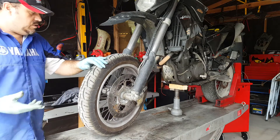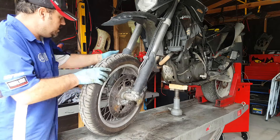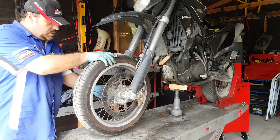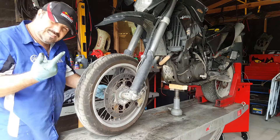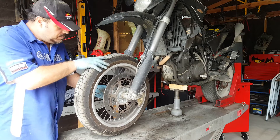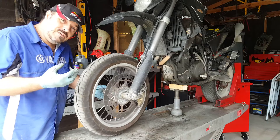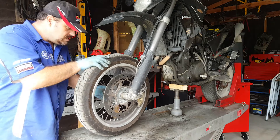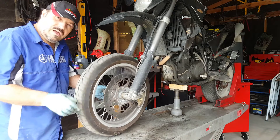There are actually three checks we can do — we can also check the wheel bearings while we're at it. First of all, hold the bottom of one of the forks, spin the wheel, and you're listening and feeling at the same time. If you can feel any vibrations through the fork, or you can hear any rough noises or roughness, then you know that one of the bearings is shot.